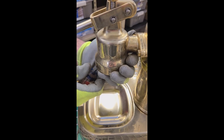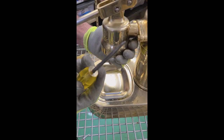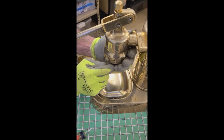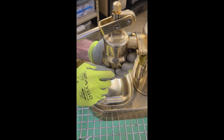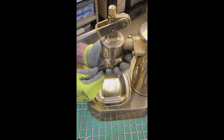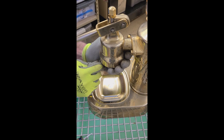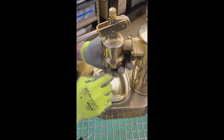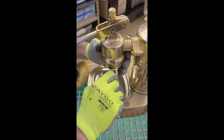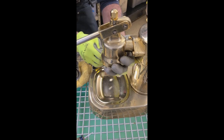When they're stuck it becomes a little more complicated, and at that point you could use a pointy tool to poke the gasket, which of course at that point the gasket will be damaged — hopefully not damaging the shower screen as well, but that's a possibility too. So we always suggest to have both on hand when replacing it, and you do the same thing with the group head upside down.